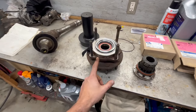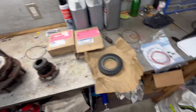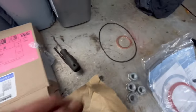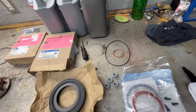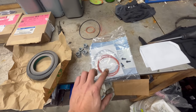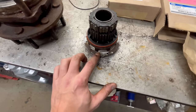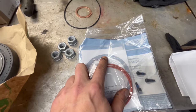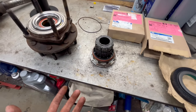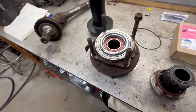Getting back to this one here - this is the O-ring that keeps the water from getting in the knuckle, in the hub. This is the new one right here. It comes with a new C-clip for locking the axle into the hub. And this is the rebuild kit for the locker. This one comes with a couple screws, which is this one right here. The gasket is right here, which comes in the kit, and then the screws go in these holes. So it's a proper rebuild kit for when you take these hubs apart, either to do U-joints or do the bearing.